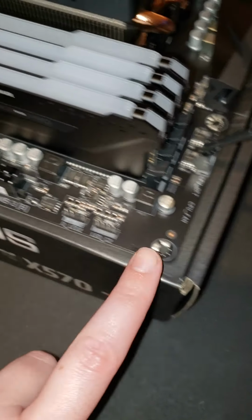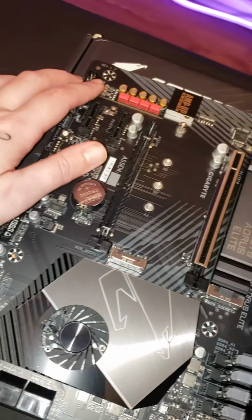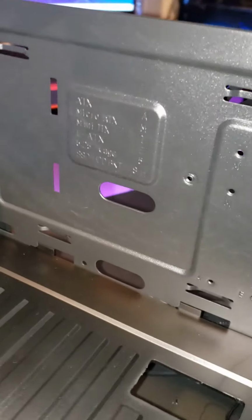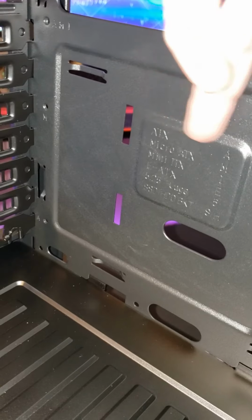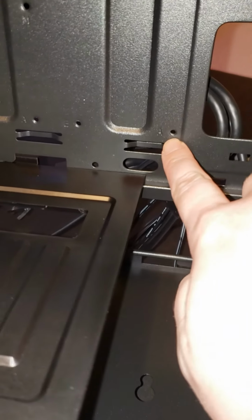And you'll see these little holes throughout your motherboard here, here, here, here. They're everywhere. And on our certain case, it will show you kind of bright. I don't know if you're able to see it, but ours is an ATX. So at the top it says ATX A. Every little spot that is marked A will be where we screw our motherboard into. Yeah, it's like a standoff screw.